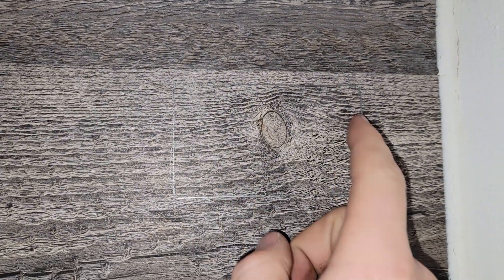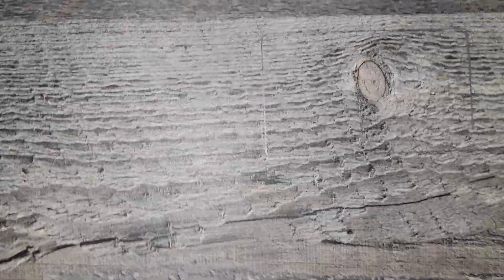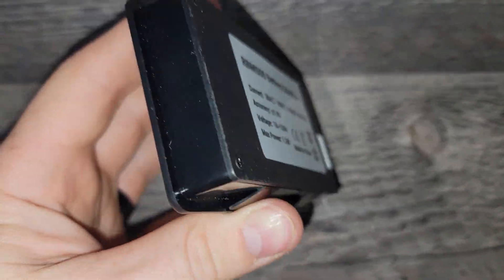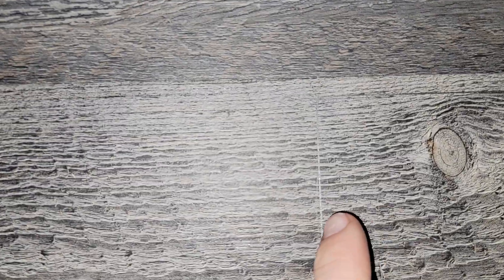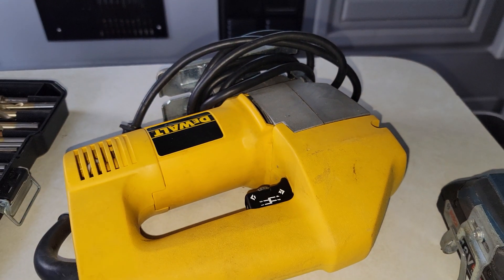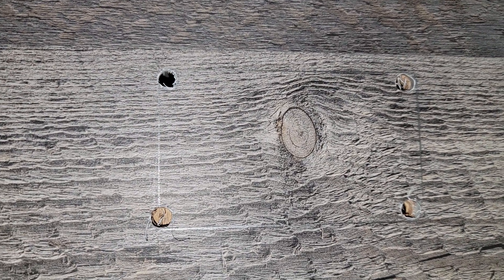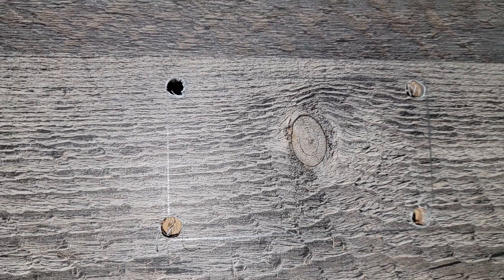Inside the camper now — I've taken my battery monitor and traced the outside on the inner edge. There's kind of a lip on it; it clicks into place with tabs. I traced the inner edge where I wanted it, and now I'm going to drill the corners, then take the jigsaw with this blade and cut open the hole, and hopefully it's accessible from the fridge side.